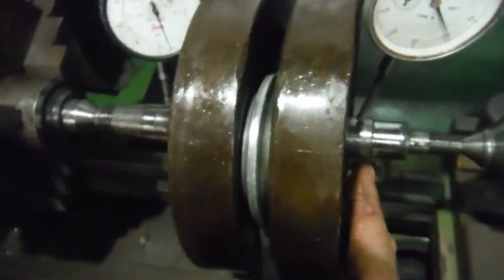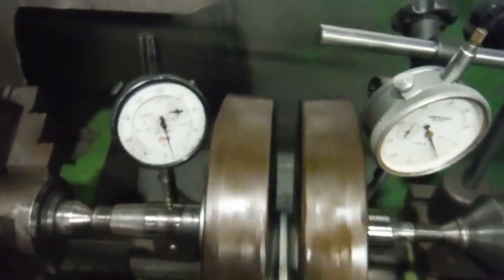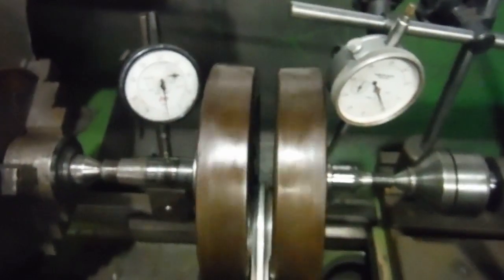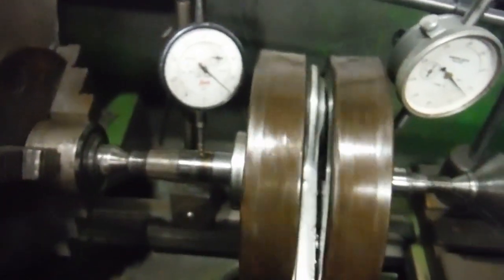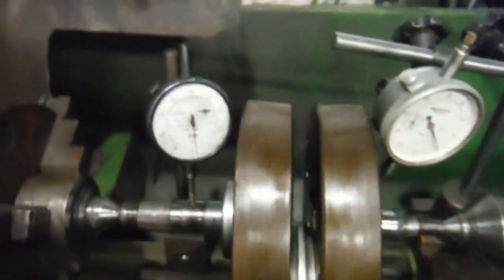So they're all going to have to be replaced. I'll probably have to replace this timing side mainshaft as well, which will mean splitting the crank, and while I'm in there I'll get a good look at the big end and the crank pin, and consider any options for the conrod if we can change it for something a little less battered and scarred. That's the run-out on this crank as it came out of the engine. Like I say, they're rising and falling together, so that is nowhere near as bad as if they were going in opposite directions.